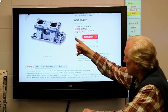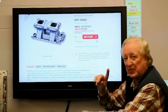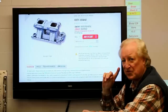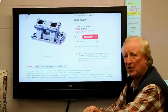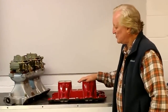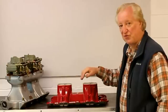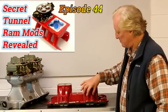Note that the plenum has provisions for two four barrel carburetors. That'll work well. But first, let's look at our alternative. This is the 21st century, and fuel injection is a pretty powerful medium for us to work with, and getting very popular. This is an updated version of the bottom half of that manifold — essentially it is the same, except it has fuel injection bosses on it.